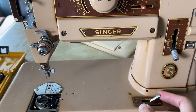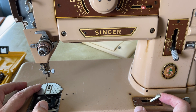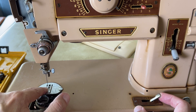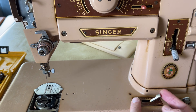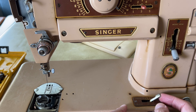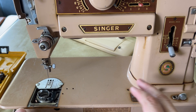I noticed when checking down here — and again, this could be this machine or almost any vintage sewing machine — this is the lever for changing the level of the feed dogs. On this series of machines — the 400, 500, and 600 series — the feed dogs don't actually drop. What happens is the plate rises, and the result is you can move fabric without the feed dogs touching it; that's for darning and free motion work. Almost every one I've handled — people either rarely or never used this feature, and because of that it's almost always stuck. This lever should flip to the left but it says no. Don't force it.